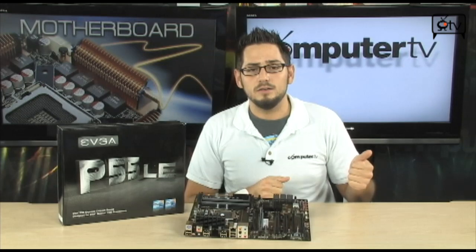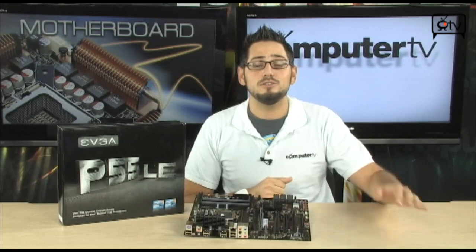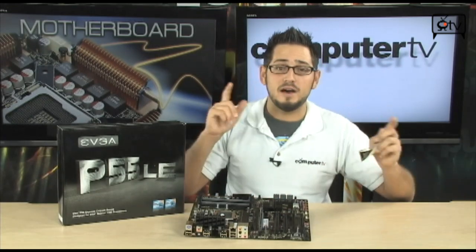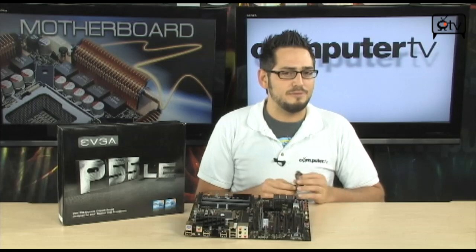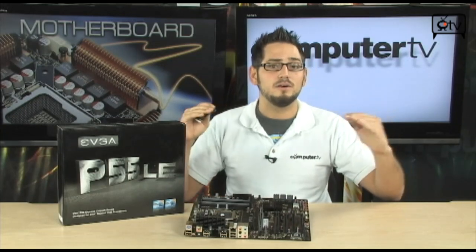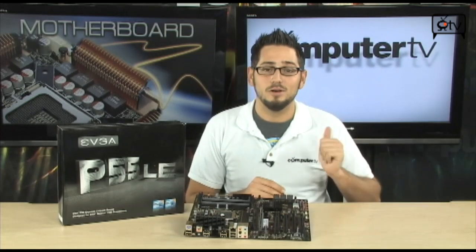Finally, the EVGA Elite Tuning Utility lets you overclock from within Windows and change your frequency on the fly. You can set up profiles with shortcuts — for example, Alt+F1 for your highest overclock, Alt+F2 for the next highest, Alt+F3 for third highest, and Alt+F4 for standard frequencies. It's not for finalizing your BIOS settings, but it really helps you figure out how high you can go before you transfer those settings to the BIOS. Works really well for base clock overclocking.